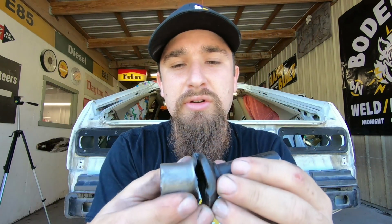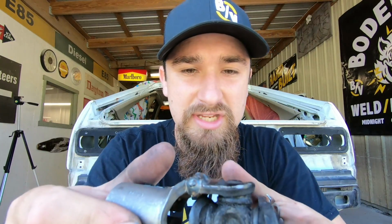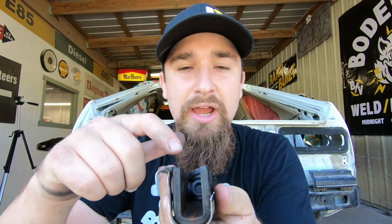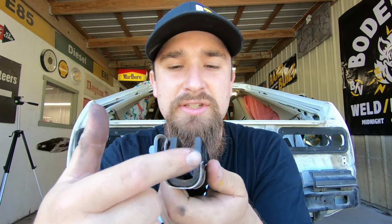And these are about the same width, so this is what I cut off from the Accord, this is what I cut off from the GTO. The width is exactly the same, and it has the exact same T swivel thing, so everything is just fine. So now what we have is 5/8 double D. This is from the GTO, and this is what was on the actual steering rack. A bolt just runs through here. This fits on the rack perfectly.